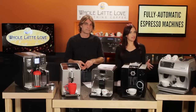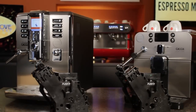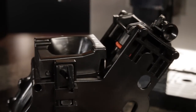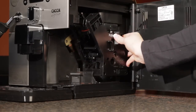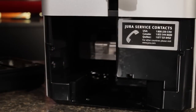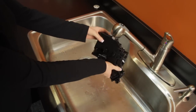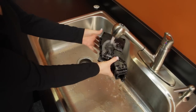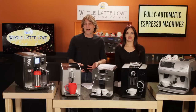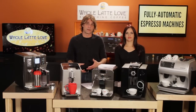There are some things to keep in mind about brew groups. For the most part, manufacturers use the same brew group in all of their machines — from their least expensive to most expensive, it's usually the same mechanism doing the brewing. Some brew groups are removable and some are not. In the unlikely event there is a problem, it's going to be a lot easier to replace if it's removable. Maintenance differs as well: if it's removable, you'll rinse it with tap water once a week or so; if not, you'll use tablets specified by the manufacturer to run a cleaning cycle periodically. Warranties are typically longer on machines with non-removable brew groups — often as long as three years, compared to one to two years on machines with removable units.